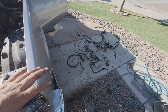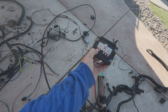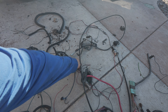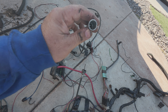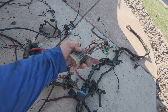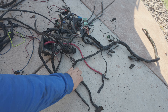On this video I'm going to go over the harness. As you can see, we pulled out a lot of stuff — some of this was aftermarket. This crap here was attached to chassis ground and it looks like it was grounding all these wires. Most of these were going to the Dakota digital gauges which it has installed, but they weren't really working. There was a ton of wiring harness that we cut out — for example this was for all the air conditioning stuff, it doesn't have any AC parts at all. A lot of this stuff here was for emissions, like the evap valves and different stuff — we ripped that off.